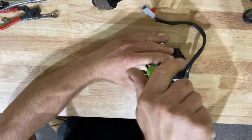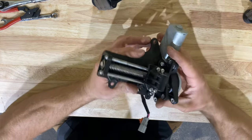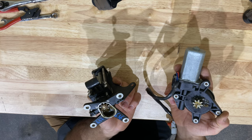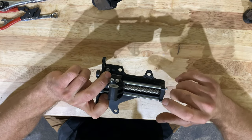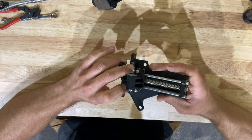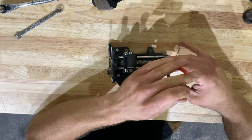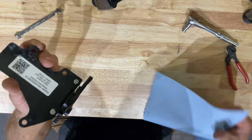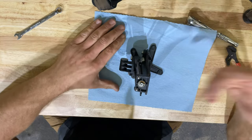Let's remove these four Phillips head screws. The four Phillips screws are done — you can now separate the window motor from the actual track and gear assembly. Set this on a shop rag so you don't get grease all over the place, then we're going to proceed to disassembling this. Before completely removing these two 8-millimeter bolts, I like to get the two nuts off first. That way, once the nuts and snap ring are off, I can push it down and wiggle it out of place.